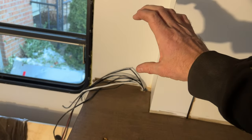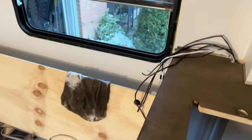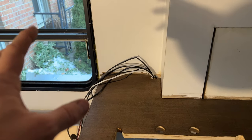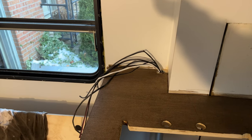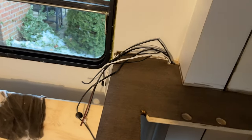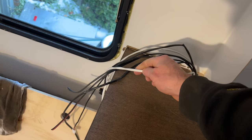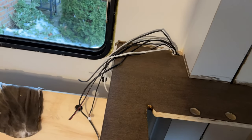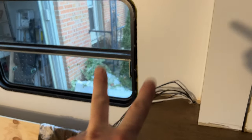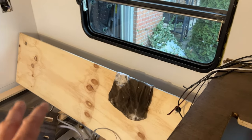Up here I'm going to have a tank monitor to check my gray tank for the sink and also my two fresh water tanks. I'm running 14-gauge power for the monitor because it also runs the pump. For the tank monitors you could go with 18 or 20 gauge, but I'm running 16-gauge marine shielded wire — it's better than regular, nice and soft even in the cold and really flexible. I'll run one line to each tank, two wires, for monitoring the levels.